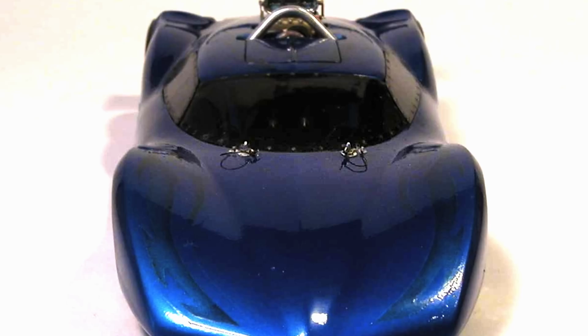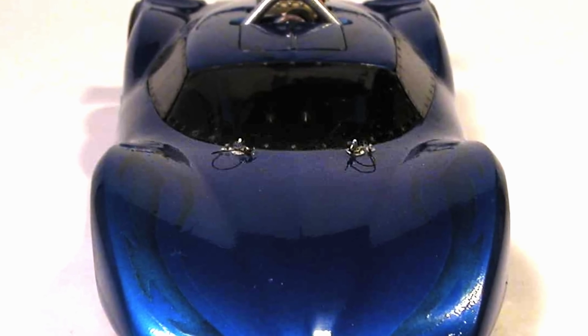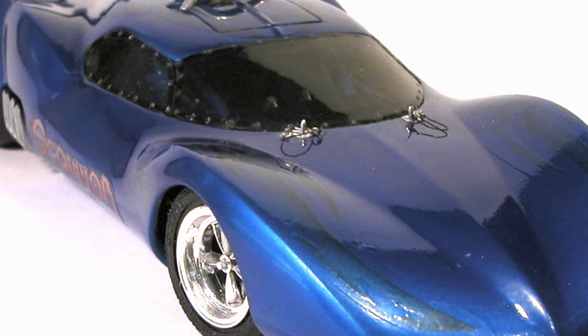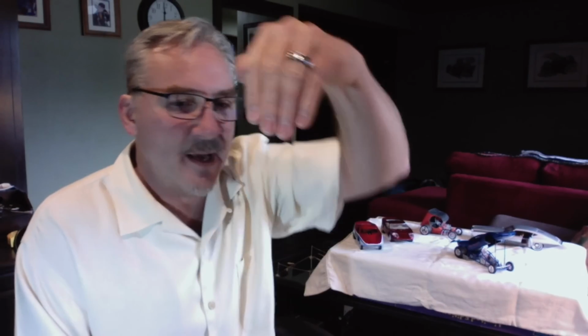And I think the hood pins, the functioning hood pins, I had to figure that one out. You got to bend them the right way. You got to wrap it around something and bend it with the right kink and find the right wire. But drilling a hole in the side of a rod, that was the hard part. How am I going to do that? And I failed, crooked off to the side. I'm like, how am I going to do that?